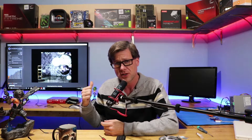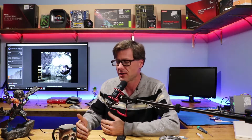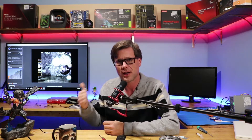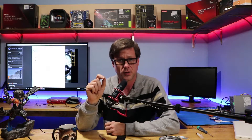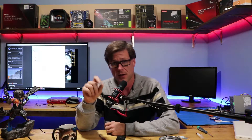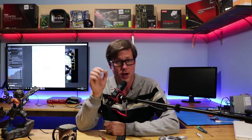I started running the benchmark. It got halfway through the benchmarks under 70°C. I finally made it to 70 and the fans came up a little bit. The highest it got on that first test was 81°C and it never ramped up to full speed. On the original test, the best I could score was a 93 on Cinebench. On the water cooling, the best I could achieve was 103. I popped this thing together just changing out the thermal pad for thermal paste, and I was able to achieve 102 on Cinebench — and the fans weren't near as fast or obnoxious. I was absolutely completely shocked.